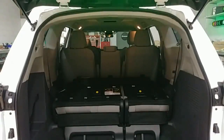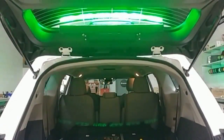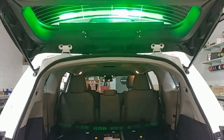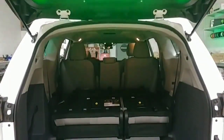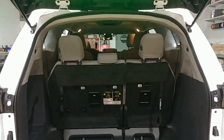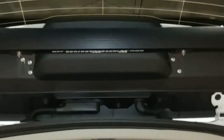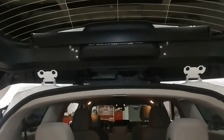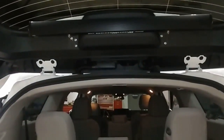Because this van is going to be picking up kids and they're probably going to have all kinds of backpacks and stuff being thrown in and out of the back, we went ahead and mounted the light stick in the rear window. This van isn't really doing security work where that hatch is going to be open while it's working, so I felt no need to put that light stick inside. It's okay if it raises with the van door because if the van door is up, they're really not going to be working there. We mounted it using an in-house bracket we made up, got a little bit of meat right there in the hatch area, and wired it all through the factory boot on the right-hand side — fairly easy and we were able to keep it all clean and discreet.